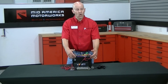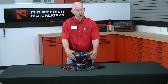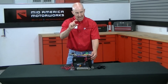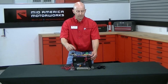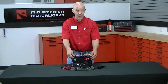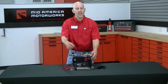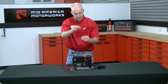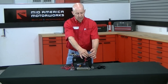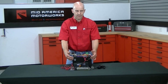If you want to install this on side terminal batteries, you can go to your local GM dealer or local ACDelco distributor and ask for an extra-long battery bolt and a battery terminal spacer. They will be able to look that up in the catalog and supply you with one for each. Then you put the eyelet underneath the battery bolt, put the spacer on top of that, thread it through the battery terminal, and torque your side terminals to 11 foot-pounds.